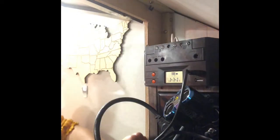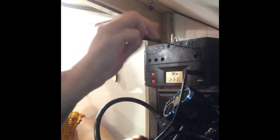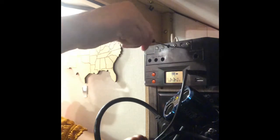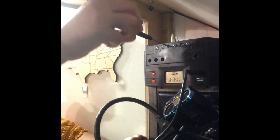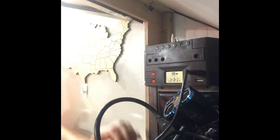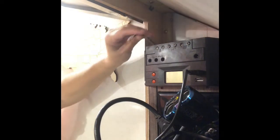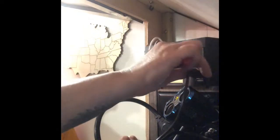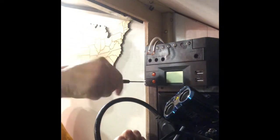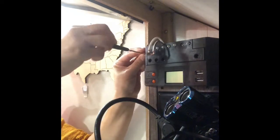I'll go ahead and take out this PWM controller. I know it's upside down but that was the best situation with one of the cables coming out. The RV came with a solar controller but the one it came with is only rated for a 40 watt panel, and I have purchased a 100 watt Renogy panel. I've already placed that on top of the RV, so now I'm switching out the controllers.